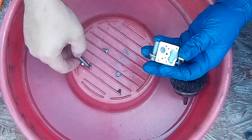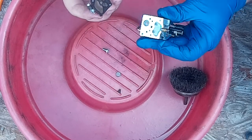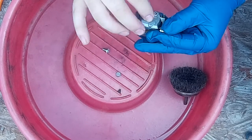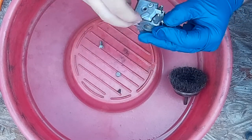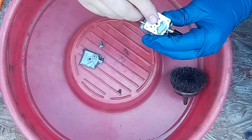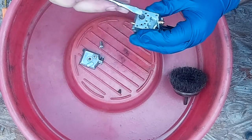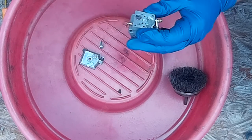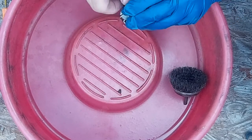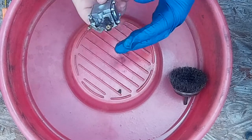Take your time and search for the right one. I'm not doing anything with this side - it's all pretty much open behind these two gaskets, and I don't believe there are any blockages behind that. Move your little throttle arm over so you can lay this down flat on there. Everything usually has little pins that drop into holes so it'll fit - once you lay it on there right, it's in place. Almost forgot to put the screen back in - don't forget your screen! Drop it in the hole, use a screwdriver or pick and push it back in. Don't poke a hole in it - use as flat a surface as you can and push it down until it touches the bottom. Then put your plate back on, start your screw, and tighten it up. Don't over-tighten - just nice and snug.